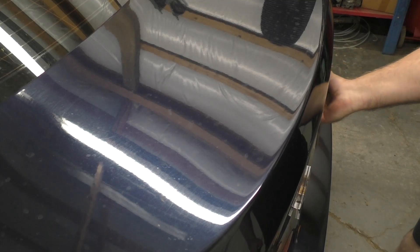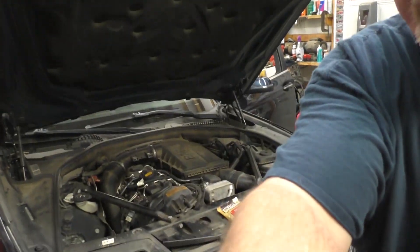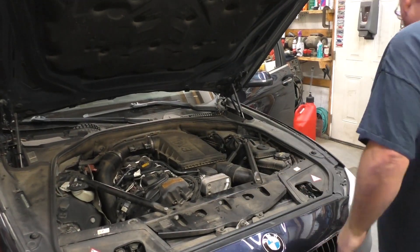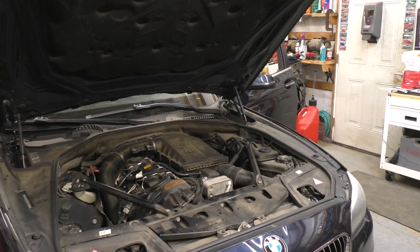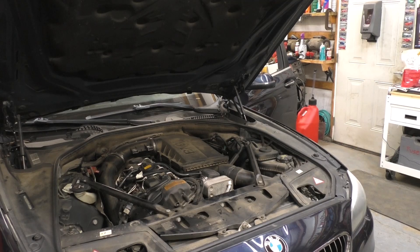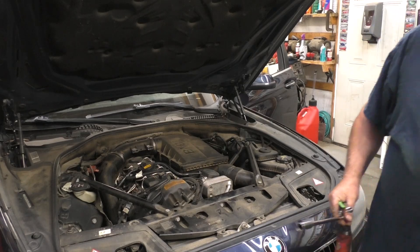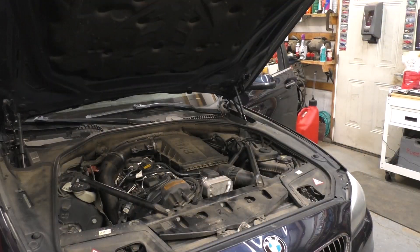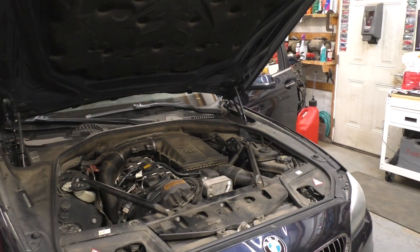Sounds a little bit rough. The license plate is loose. You're going to have to take my word for it — I don't like you all enough to start this vehicle up because it's hotter than heck out there. This thing has got a heck of a lot of crankcase vacuum in it — I mean, it's whistling. We've seen that same phenomenon on other vehicles; this is not the only one.